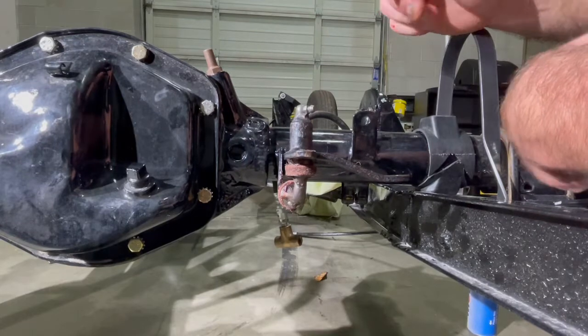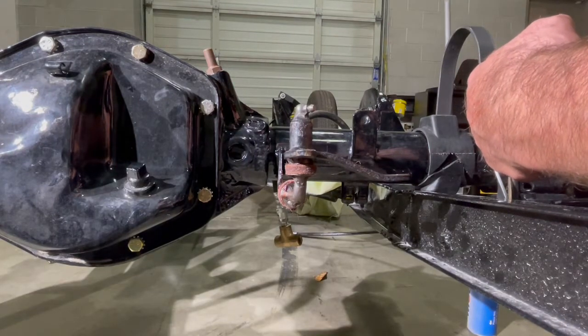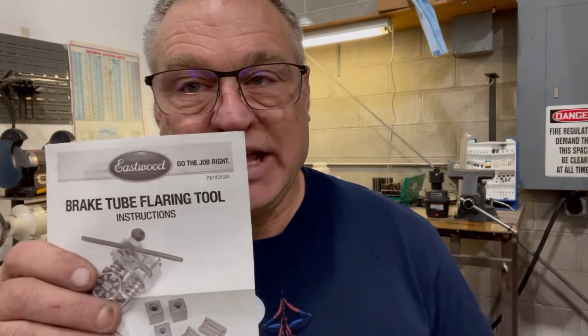I guess it'll come up from here and angle up — I was afraid of it chafing on the axle but I guess it'll be okay. This one will have to go there to clear the diff cover, and then this one will come here. So with all that mess set, now we can run our hard lines. The reason I brought you along today was really to show you how this Eastwood brake line flaring tool works — not a sponsor. The hard lines I have are for a Lockheed brake system and not a Girling, so all the hard lines on the rear axle seem to be too long. We're going to chop them off and re-flare them just like the factory did whenever they built these cars.